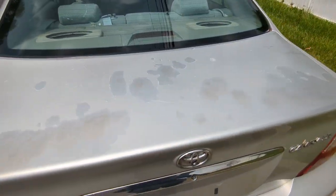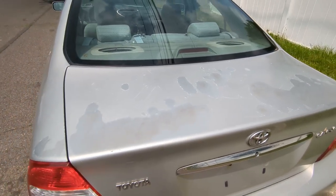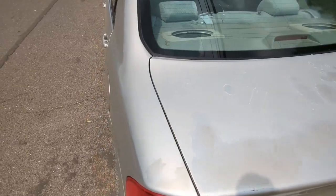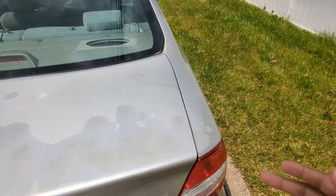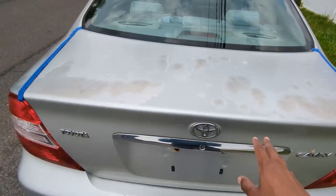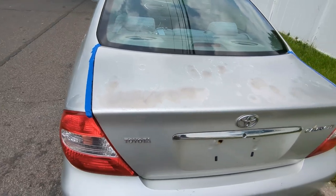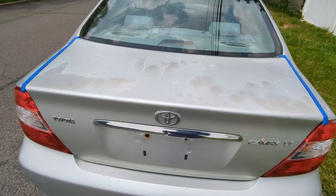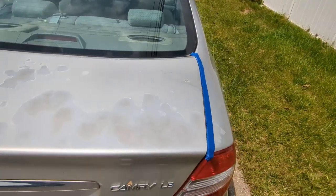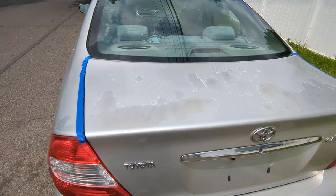Now that it's all cleaned up, the next and probably one of the most important things before painting anything is sanding the car down. If you just paint over metal without sanding it down, the paint's probably not going to stick for long. Before we sand, we're going to tape off the edges so we don't sand onto adjacent panels — just use painter's tape around those edges. Also, when you're painting a portion of the car and not the whole thing, try to do it in a section defined by a body line so it's harder to tell where old paint ends and new paint begins.